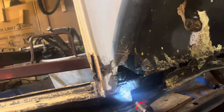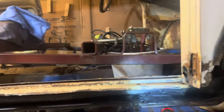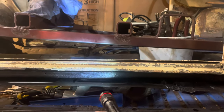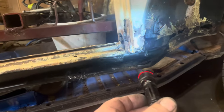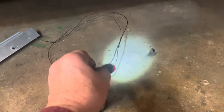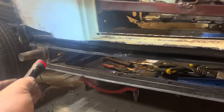I'm rather proud of making that — pretty neat. I put a patch at the end there to seal it up so my air will go through now. As far as these holes, I'll be able to fix those with seam sealer. Every time I touch it with a welder it's like welding a beer can — you just can't do it. I coated the inside with a base coat — I ran a rag of base coat through it using a piece of wire threaded through with a sock tied at the end, going through three or four times.